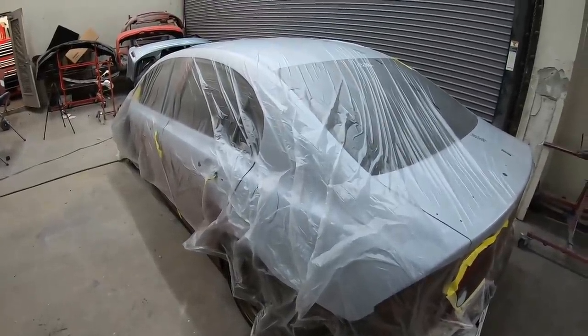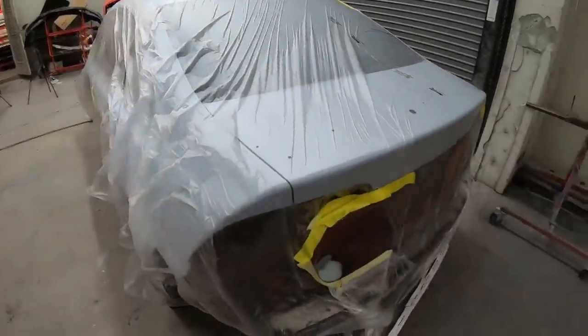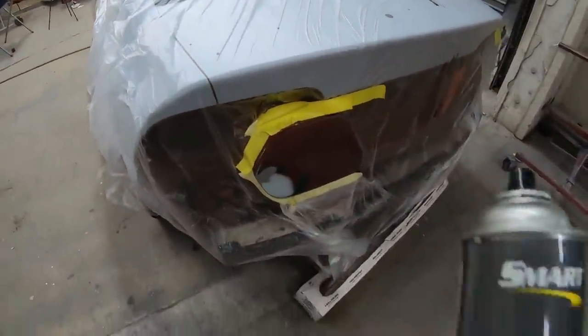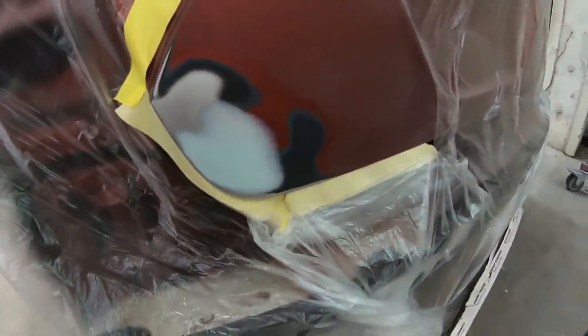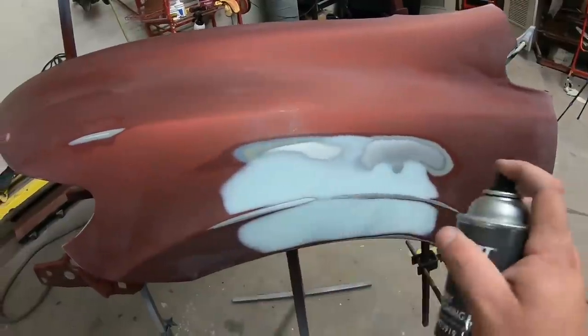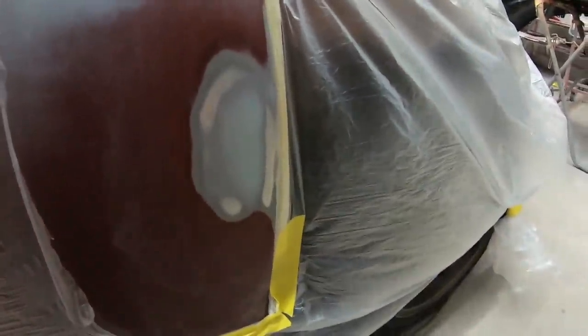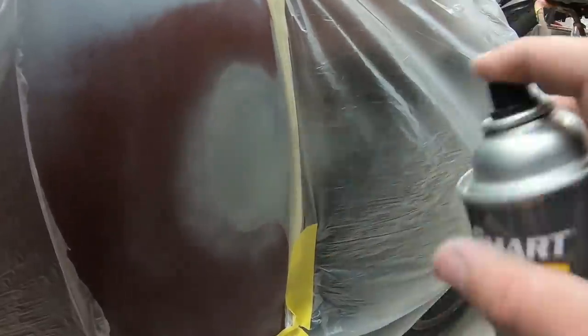After it's all been sanded, we bagged up the car — it's so important to get plastic up on the car so you don't get any overspray going all over. Similar to what we saw in episode 2, we have our self-etching primer. We've got a little bare metal here, so we'll just use a little bit of etching primer to cover that up — you don't need to go over the filler with it. As long as our metal is protected we're good. We have just a little bit on the door as well, so we'll give it a little bit of a sprinkle. I'll let this flash for about a good 10 minutes — no need to sand it — and then we can proceed with our surfacer primer.